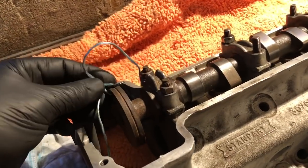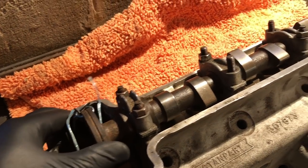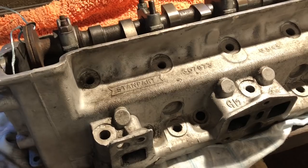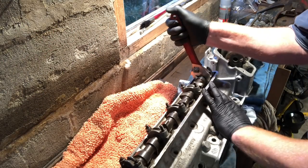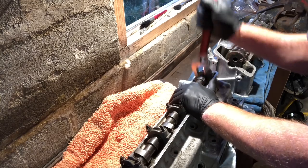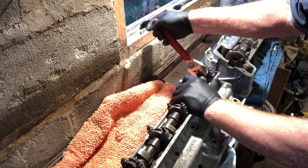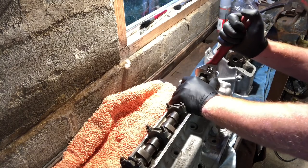I've done it with this one. Now I need to come back to the left-hand one where you'll see that someone has actually left the lock washers tied up with string on the sprocket pulley. I've worked out there's a spanner that you can attach to the back of the cam to actually rotate it, because obviously it's out of the engine and not turning under its own steam. I've been using an adjustable spanner in the gap here. It's a bit of a fiddle — this square drive at the back of the cam drives it around, and you can see the whole cam moving across and around as the springs resist it, going through some flat spots and some easier spots.